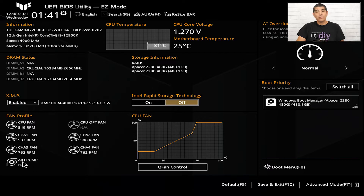Directly below, we'll also see the AIO pump. Currently it doesn't display anything, so I'll go ahead and connect the AIO pump. Now we can see it's registering an active RPM. Keep in mind the RPM will fluctuate slightly but will generally maintain a fairly consistent value. You don't need to define any configuration parameters for the AIO pump header, as it's automatically preset to operate with all AIO pumps connected to that header.